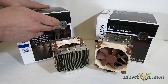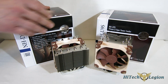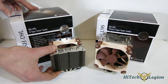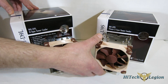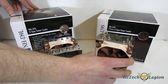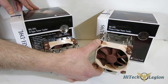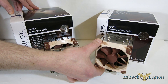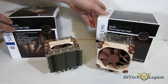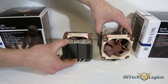The big difference you see here is full 3U compatibility on the D9L, and the S version with better compatibility. 3U compatibility calls for it to be 110mm or shorter, which the D9L is. As for the S version — as we've seen before with the 12S and the 14S — we really don't know if it stands for slim or silent, because both have 100% RAM compatibility and are very, very silent coolers. Once you get rid of the boxes, that's kind of where the similarities end, except for the fact that they are both low profile coolers.